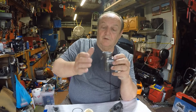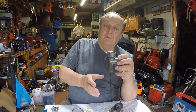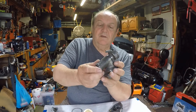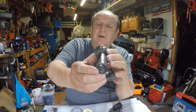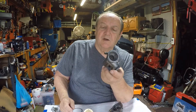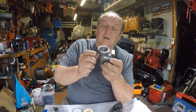When your system gets hot, the radiator cap has a spring — it comes up but doesn't let the water out; instead it sends it down into your expansion bottle. Then when it cools, it sucks the coolant back in to keep air out of the system. But looking at this, it's white right at the tip and in the spout — all filled up with calcium because the hole is so small.